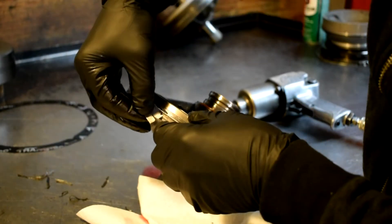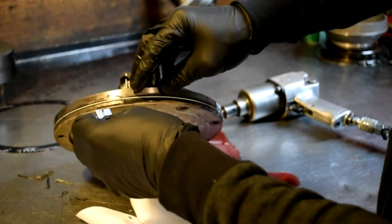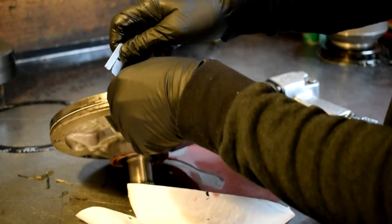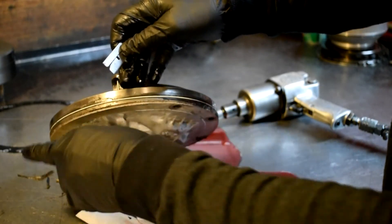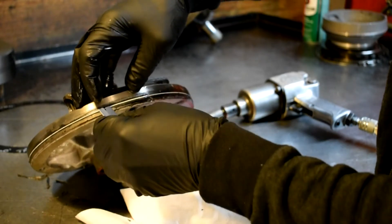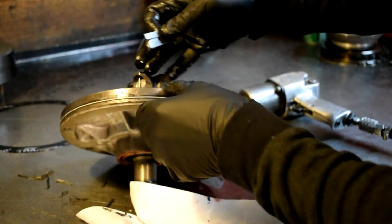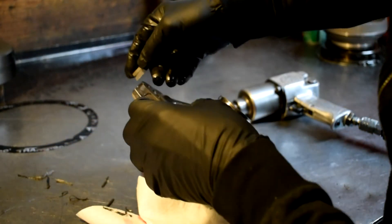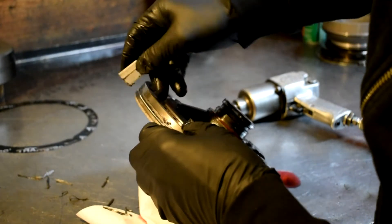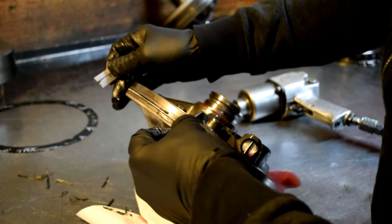Using silicone is a stupid idea — it's unnecessary. The best thing to do is check and make sure the surface where it really gets nicked is on the case. It's aluminum, so the case will nick, but the steel pump cover won't. That's where you want to check to make sure your O-ring can seal properly. Otherwise, they don't leak.